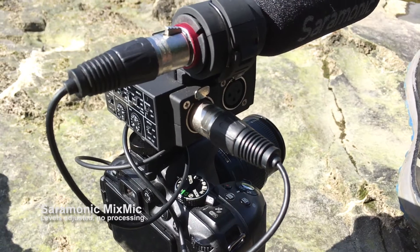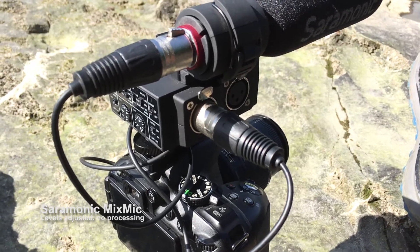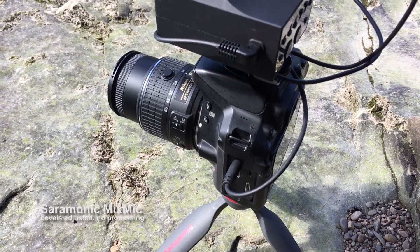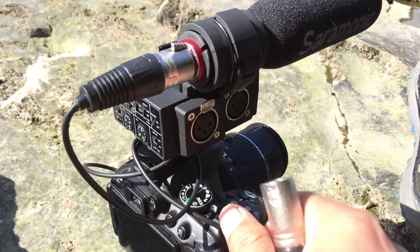The other thing is the XLR cable that comes with this microphone. It's kind of thin and flimsy — quality-wise it seems okay, but it's plastic-coated, not silicone-coated. The cable that comes from the MixMic itself into the camera is silicone-coated, so it can take quite a bit of abuse — it can be twisted and bent and nothing bothers it. The other problem is the supplied cable doesn't quite fit properly into the XLR socket. It goes in, but XLR sockets click into place with a lever to release it, and with this one I don't need to hit the release lever — I can just pull the cable straight out.